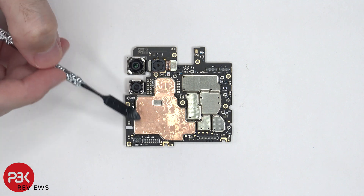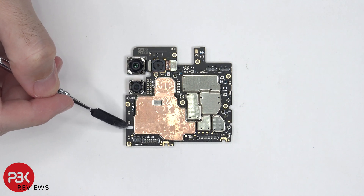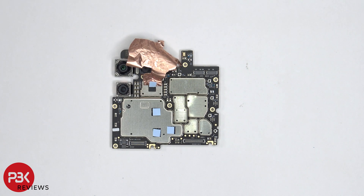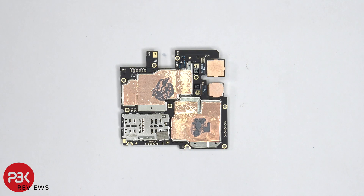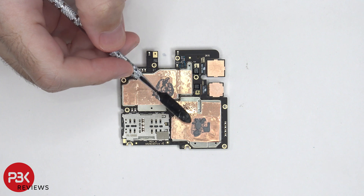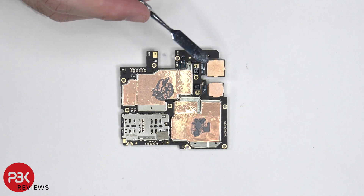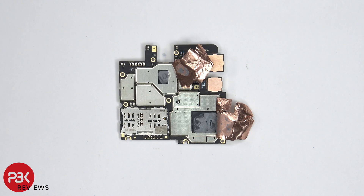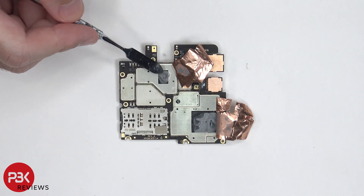On this side of the main board, we can see copper tape on the shield over here, and there's a liquid damage indicator — this white sticker over here. There's a third microphone located over here on top. Once the copper tape is peeled back, we can see thermal pads on top of these chips. On the other side, we can see more copper tape on top of the shields, as well as thermal paste over here. The other two camera connectors are over here, both of which can be disconnected by just popping them off. Your SIM card and memory card reader is located right over here. Once the copper tape is peeled back, we can see more thermal paste on top of the processor, RAM, and the chip over here.